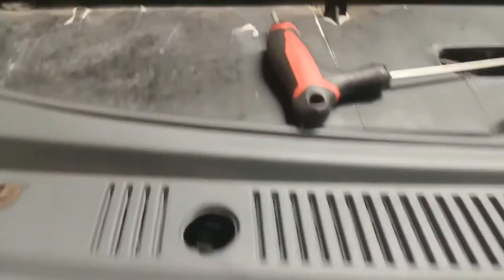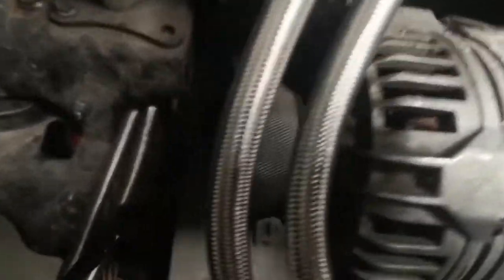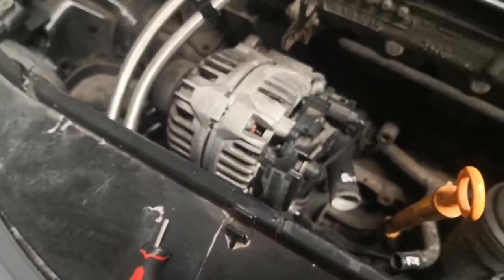It's all mounted now - you can see it's fastened in there, both pipes on. That's the feed there and that's the outlet. This is the return coming from the fuel rail and both pipes come through that slotted bit and then up into the fuel rail, with plenty of clearance on the alternator and belt. I think I'm going to try and put that little fuel filter in the feed line down here where it's still accessible and out of the way. If it's too much of a blockage I'll have to remove it and just replace it with a bit of pipe.